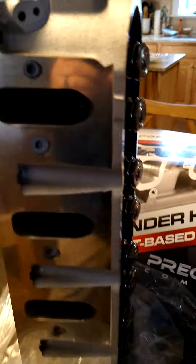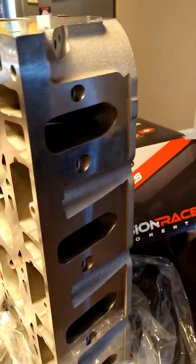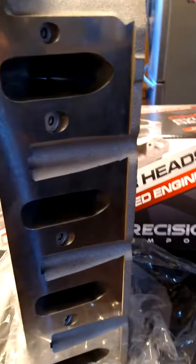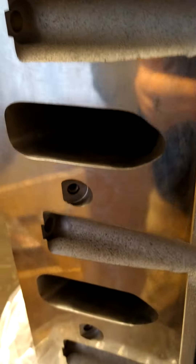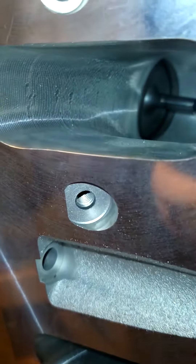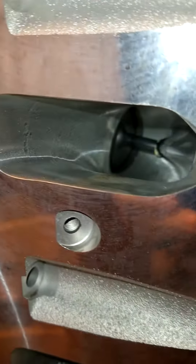These are $799 castings I sent out. It's just a stage one, just a skim pass valve job, new valve springs in there, all nice CNC port work done. Comes back a really nice piece for the money. Just wanted to share that — take a look inside the ports there, looks really good, can't complain for the money.